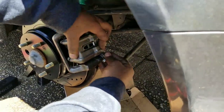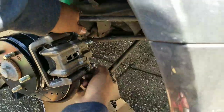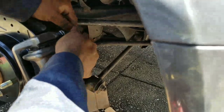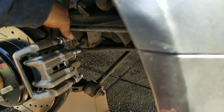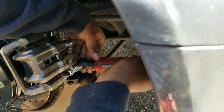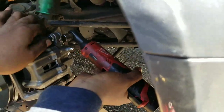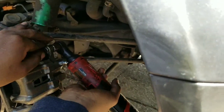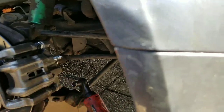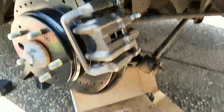Put this bolt back in and then put this bolt back in, and tighten this down. Hold that - put your finger here to hold the nut. This is tight - this goes up to about 30 foot-pounds of torque, so it's good to go. And that's it - you installed your new brake caliper. If you guys have any questions, don't forget to like, share, subscribe, and comment. Peace.